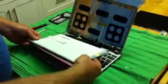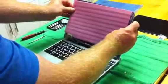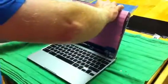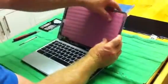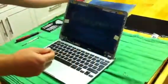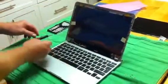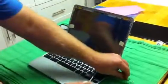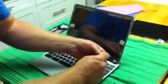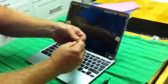Now it's just a matter of gently lifting the screen up. Keep in mind you don't want to accidentally hit the power button, so watch the power button in the right-hand corner. Place the screen up and get it into place — it'll just find its own position and set back into place. Move the protective foam from the top, put your screws back in, and the bezel has to go back on again. And we're done. Thank you.